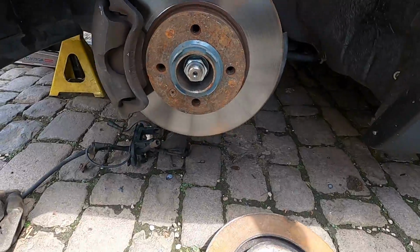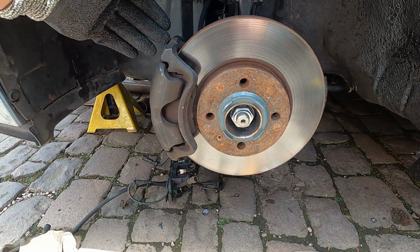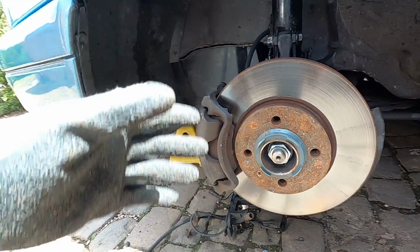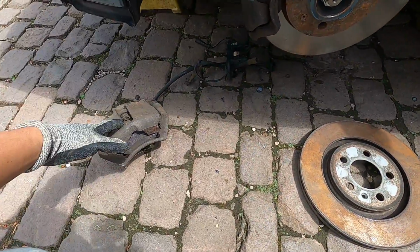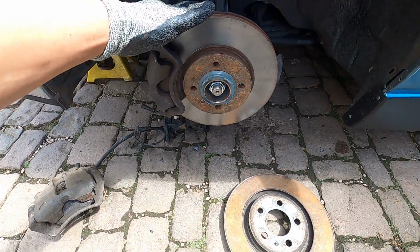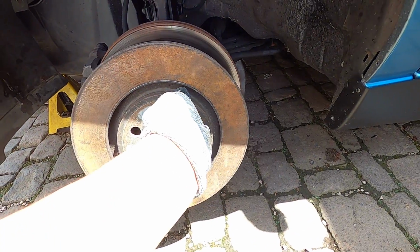This here is our current brake setup, 256mm rotor with our standard American spec 2.0 caliper here. I've never had any issues with this car stopping or felt like the car couldn't stop enough, but obviously a bigger rotor, a better caliper, more stopping power is always good to have. You can see the obvious size difference between the 256 and the 280 we're running.